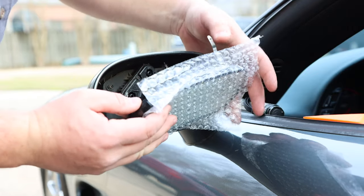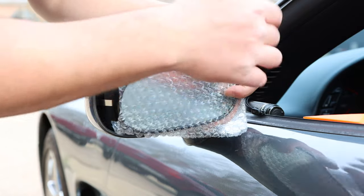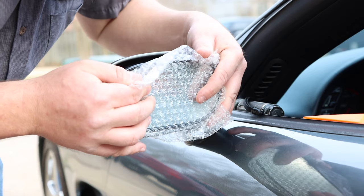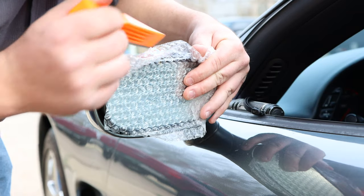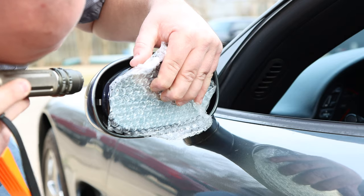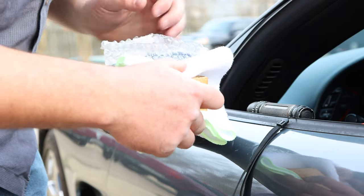Now I've got to make sure the little springy aluminum ends go inside the housing. I'd recommend having a flashlight. I'm going to sit here and try to line up the actuator arms and all the holes to the right spot and get it centered — this is definitely not the easiest thing to do, but you just kind of have to guess at it and use your tool to help line it up. I think I've got the two lined up properly — I'm going to double check — looks good on my end. So I'm going to take my wood block, go to the center, and press.